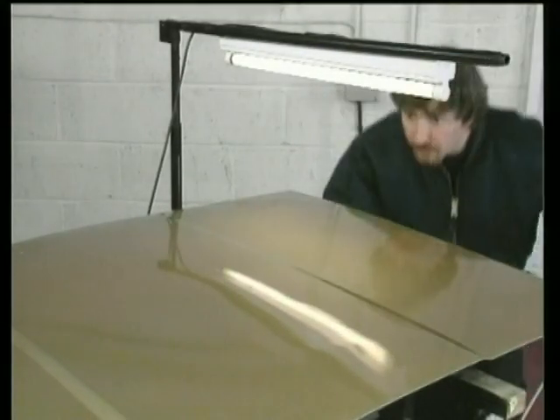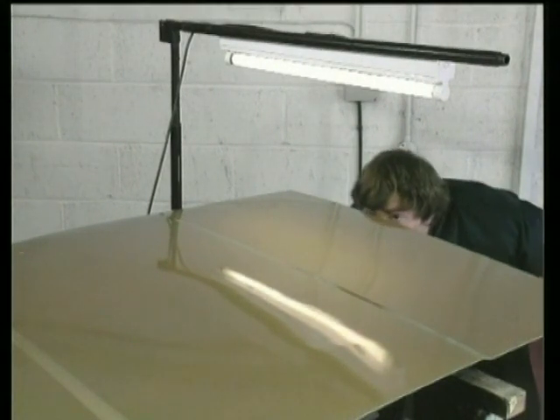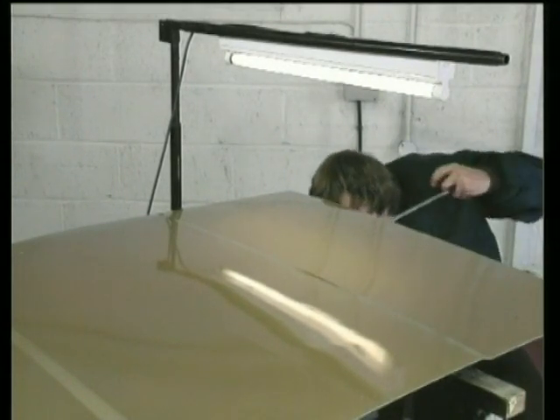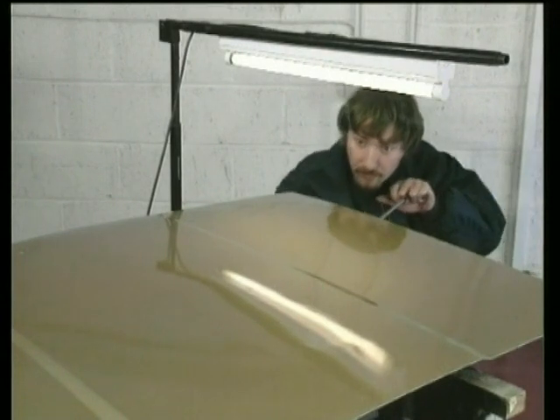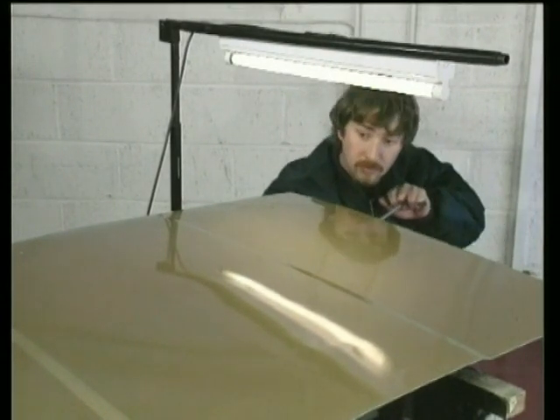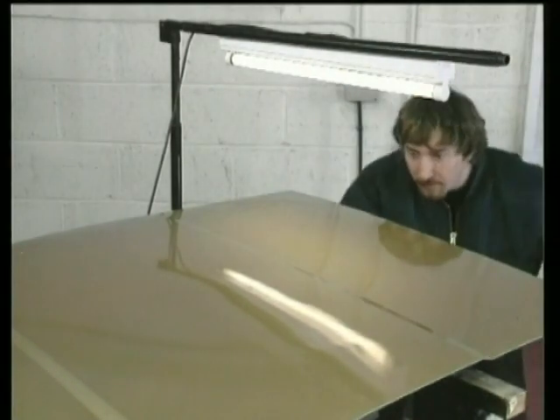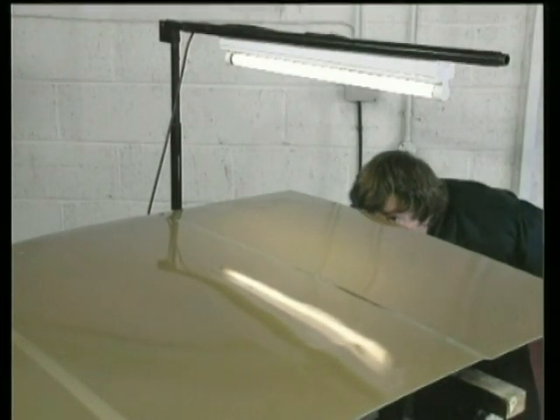A good fluorescent light will show imperfections that you would never see in daylight. The light will show you where the dents are, help you decide what strategy to use, and will confirm that the job is finished. As you will be working your tool from the opposite side of the metal, you will need to learn to use the light to show you where the tool is. To ensure the best possible reflection, we recommend that the area to be worked is polished. For this practice, polish the whole bonnet, although when you are fully proficient it will only be necessary to shine the area of the dent. Once the bonnet is polished, position the light to one side and move around until you can see its reflection in the bonnet.